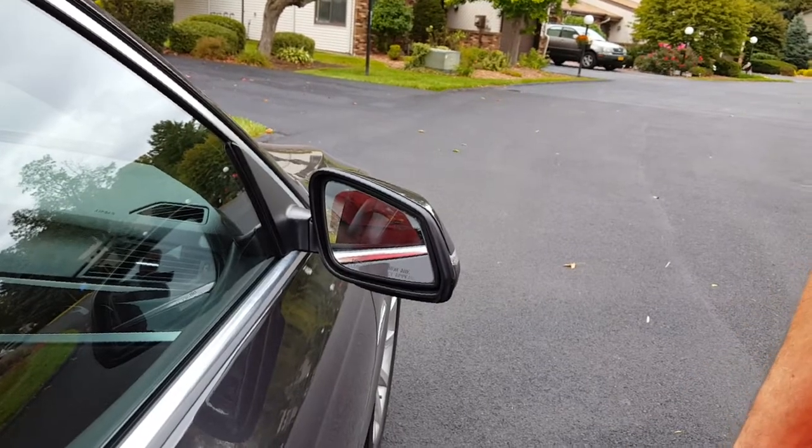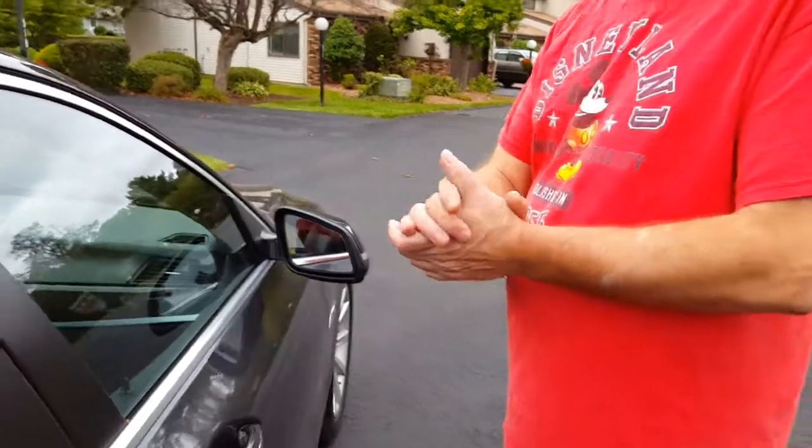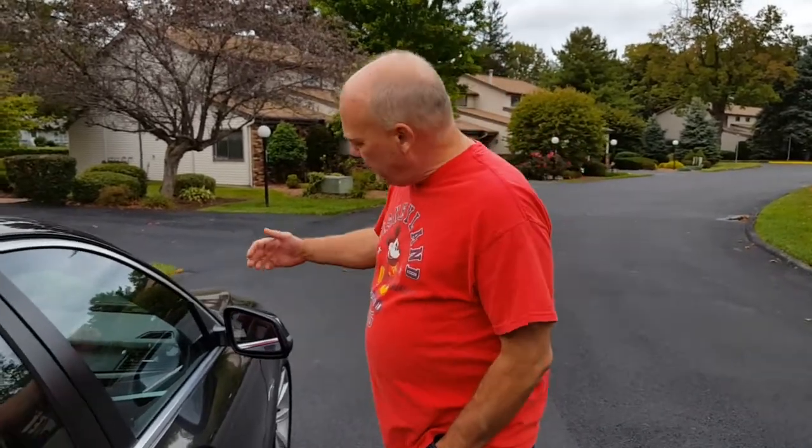I have other YouTube videos that show it where I've had it on a table. There's another video on how to repair a BMW electrochromatic self-dimming mirror that darkens 65% of translucent light. Our mirrors absorb 40% because we use first-surface U.S.-made chromium. Chromium is a translucent metal — on the first surface, which means it's on the outside of the glass; the inside is regular silicate, like regular plate glass. And my competition will claim that first-surface chromium will start to flake and destroy — but when the 1957 Chevy Bel Air had chrome bumpers that started to rust and bubble, it wasn't due to the chromium; it was due to the steel rotting.